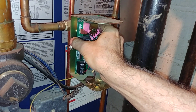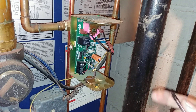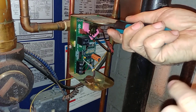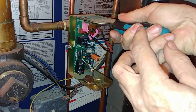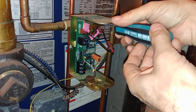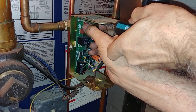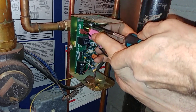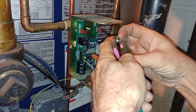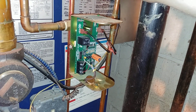Now we've got to get this board off, but first we have to get the solenoid off. There's a screw all the way back in there — it's a Phillips head, although you can't use a four-way on this. It's actually better than a Phillips — it's Japan Industrial Standard, which grips tighter. So we got that little screw out. Make sure we don't drop all the little screws and pieces.